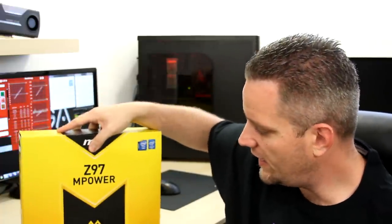Hopefully the thermal compound will hold out. This is the chip I'm going to be putting in Project Skunk Works, pairing it up with my EVGA Z97 Classified motherboard, and we'll see how well that does. In terms of overclocking, this thing is absolutely fantastic. With the 4790K, I'm hoping that once I can give more volts to it — I've seen people go as high as 1.375 volts on these chips and still maintain amazing temperatures on water — I'm hoping for a 4.8-ish. 5.0 is not going to happen with this chip — it's taking too many volts just to get to 4.6.